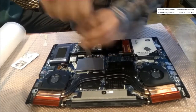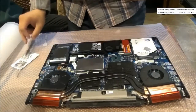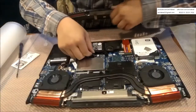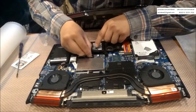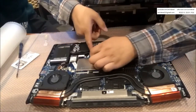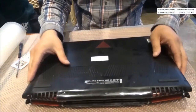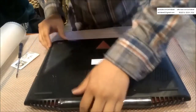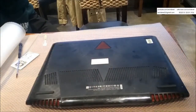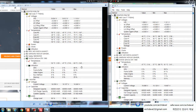Use a crossway tightening pattern, then put the battery cable back — don't forget to reconnect it. I'll skip ahead to the Fire Strike results. The left result is before repasting and the right is after. The maximum CPU temperature before was 75°C and the GPU was 63°C.